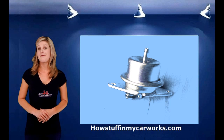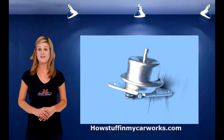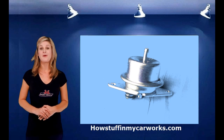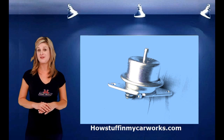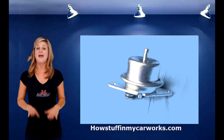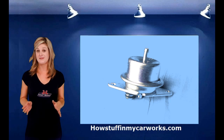Some of the most common symptoms of a malfunctioning fuel pressure regulator include: your vehicle may be hard to start, have a rough idle, black smoke, or excessive fuel consumption. Also, take note that there is not a specific OBD2 code for a malfunctioning fuel pressure regulator. For example, a malfunctioning regulator could trigger a bad oxygen sensor code, among others. This is because the regulator is a mechanical device.